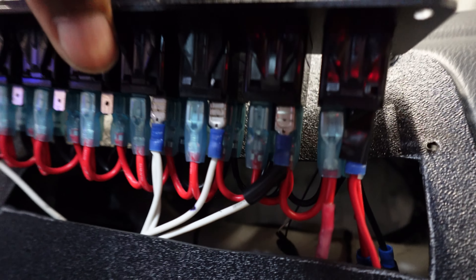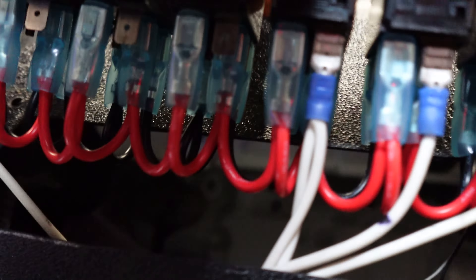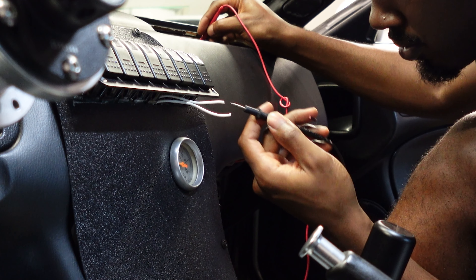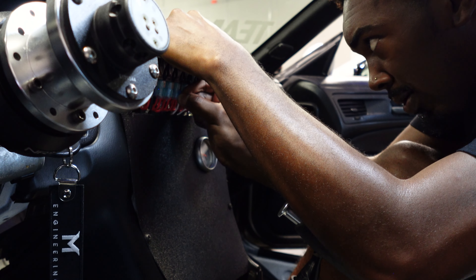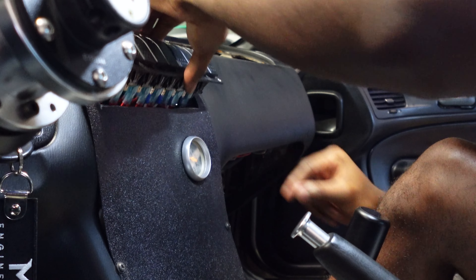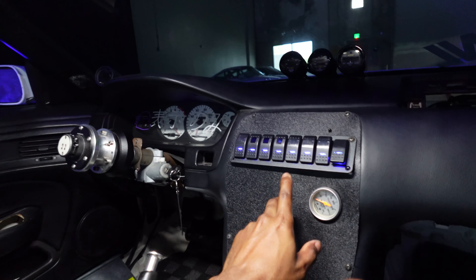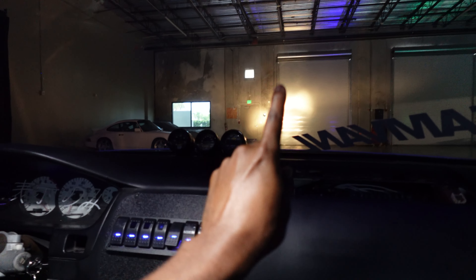Main power, this is ECU gauges. Where these two merge and split together is what we need to disconnect and turn into two switches instead of one. When I hit the switch, I retain that same light switch as the headlight/tail light — ECU gauges, headlight, tail light. Yes, it turns them on, but those aren't all the headlights.